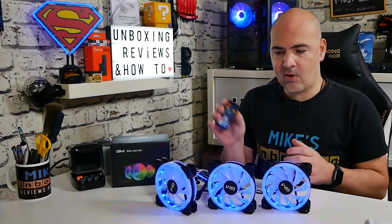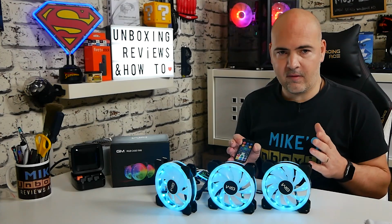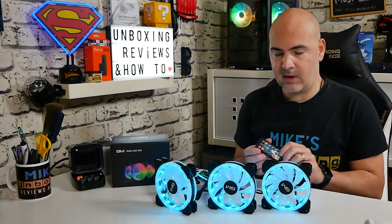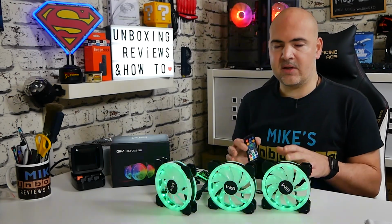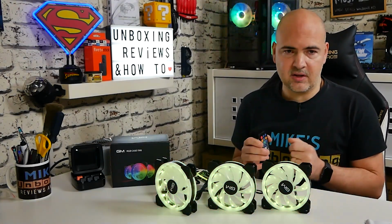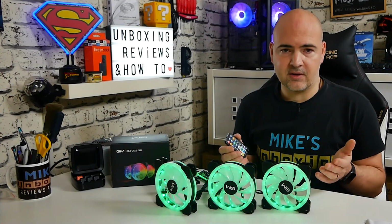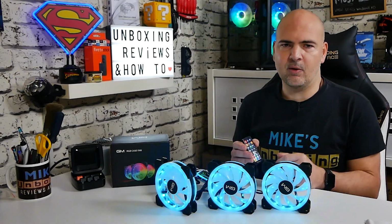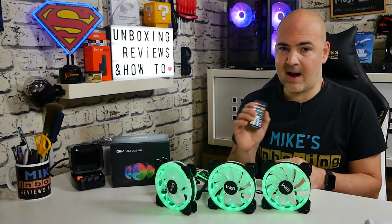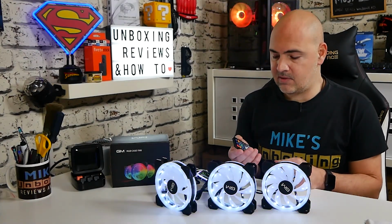So fan wise, let's go into the fan. With the fan control, there is no PWM or voltage control directly to your motherboard, so it is all done from the remote control. And one thing you will notice is whenever you power these up for the first time, they will be set to the default speed of basically full speed, so 1200 RPM, which some of you may find a little bit noisy. So you might find it a little bit frustrating to actually dig out your remote control every time you boot up the PC to reduce the fan speed.